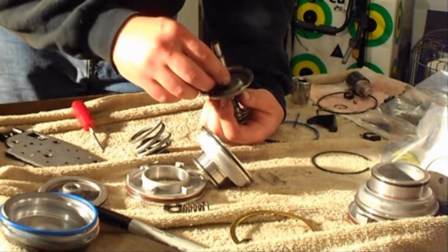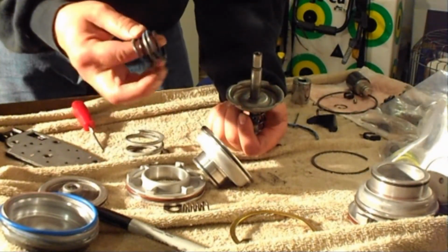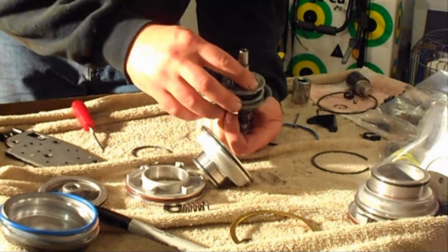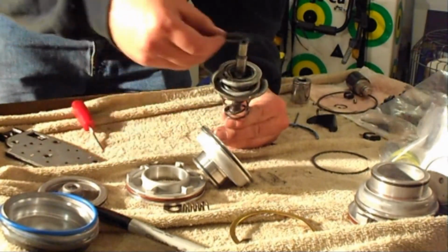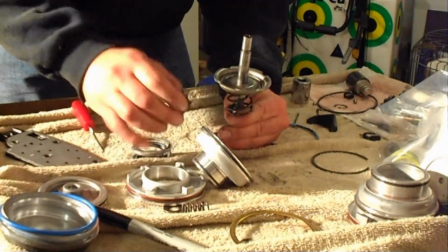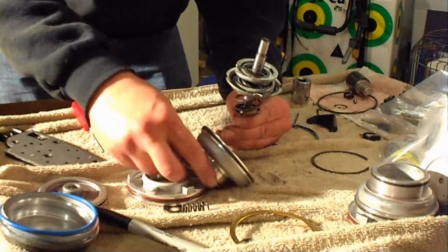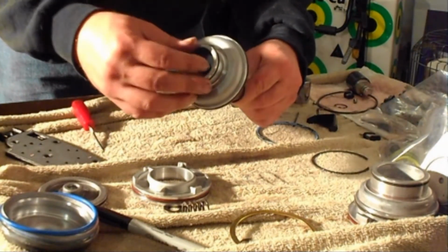Going ahead and sealing this back together now. I got the pins it came with. Came with a new black one, new blue one. Stick those in there. Got the original spring that was in the assembly. Before all that, there's this little coil spacer you're supposed to put in, then the black screen, and the blue spring, and the original spring goes over top of all of them. Then you go ahead and slide the second piston onto the assembly here.